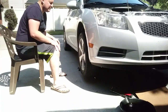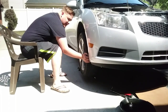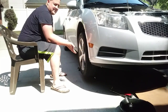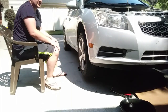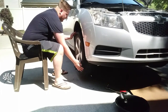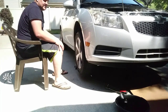While we let that drain, I'm going to show you a couple other tricks. One tip to check if your suspension is good: put one hand at three o'clock and one at nine o'clock, shake it back and forth to check your tie rod ends — in this case it's good. The other check is at twelve o'clock and six o'clock for your ball joints — also good. If you have a bad wheel bearing, you'll feel play all around the wheel no matter where you put your hands, and in that case you'll definitely be replacing some components.